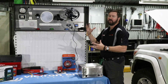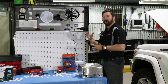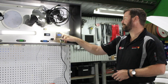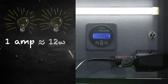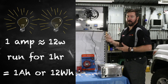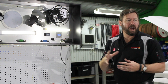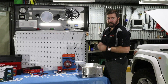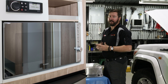We'll look at a few different items that we're going to run. We've even got a trusty little pie warmer here to show you what a larger load will draw, and we'll talk about things that we can and can't do on the road. Small LED lights are drawing between the two of them up to about one amp — that equates to 12 or 13 watts. The main items we need to be concerned about are our cooling devices — refrigeration — and our heating or cooking. Those are our larger items that are going to drain and flatten our batteries pretty quickly.